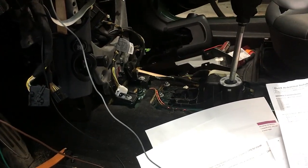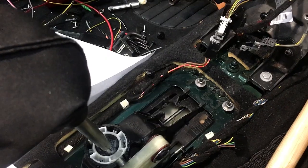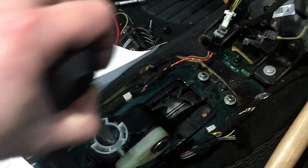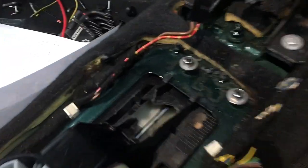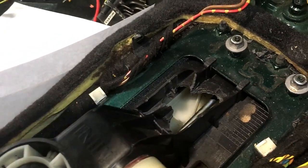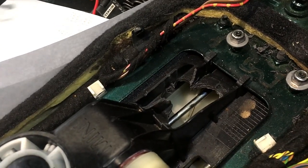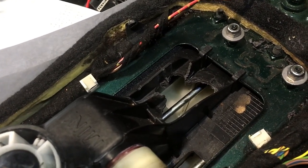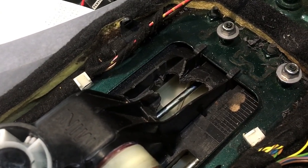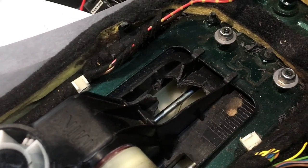I'm going to go to the other side of the car and I'll show you how this is going to work, or how I think it's going to work. I've already gotten some of the plastic out of the way. You can see there's some black grease on there. When the shifter is in neutral, that rod is only in one place. So what we're going to do is get a shaft collar and put it on that rod. We're going to make a little bracket and I've got a little proximity switch that's going to sense when it's in neutral.